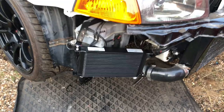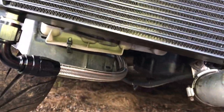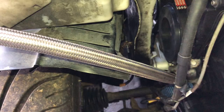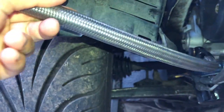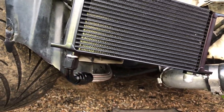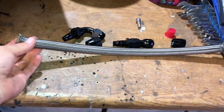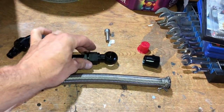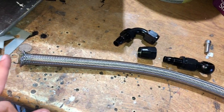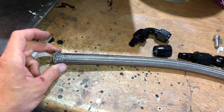In the previous episode you saw me making up the oil cooler bracket and pipework. The lines were about an inch and a half too short after moving the oil cooler, so I've just redone this one. It's still in mock-up stage so everything is loose and ready to be tightened. I'm going to show you how to make these lines up because some people in the last episode said they'd like to see it done. I'll show you how to make these yourself from AN fittings and stainless braided hosing. So here's the hose stripped down - I've taken the fittings off to reuse them. This hose needs to be an inch and a half longer - not a lot, but enough to put too much tension on the hose and risk problems with the oil cooler.